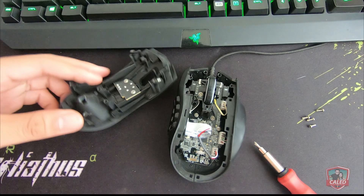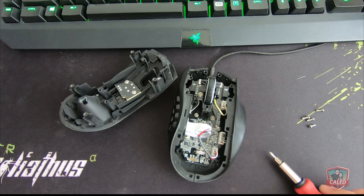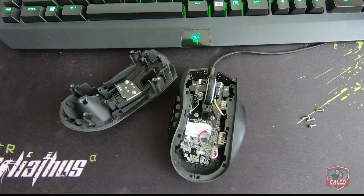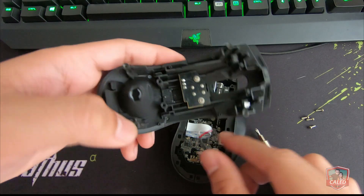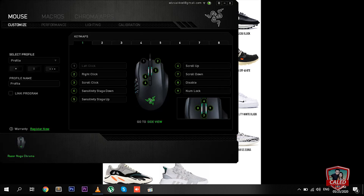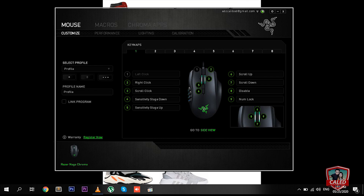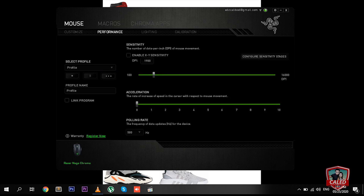So how should we fix this? Well, you have various options. You can either buy a desoldering set and reconnect the wires, or go to local shops which offer soldering services. Alternatively, you can try what I did. Since the ECQ and GCQ is still imposed in our community, there's no hope for buying or ordering soldering sets — the wait is too long. So what I did is manually set the DPI of the mouse to a fixed value using Razer Synapse software. This workaround takes more time than using the DPI buttons, but at the very least, less than a minute is enough.